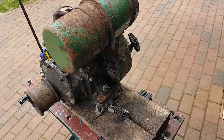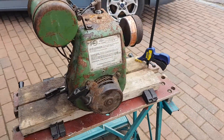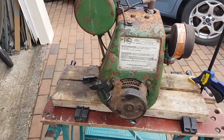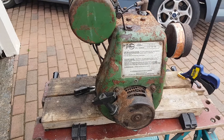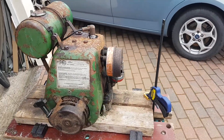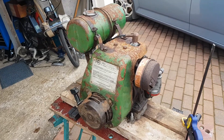I had to tinker around with it to get a better spark and take the flywheel off, which has got a really clever mechanism built in to do that. Clean the points up, fitted a new stop cable on it, and typical English spark — it's barely an orange glow, but actually it starts really nicely.